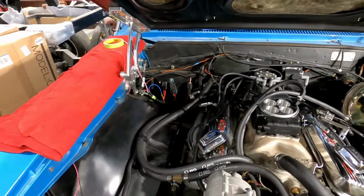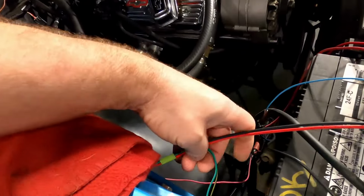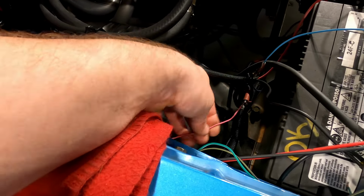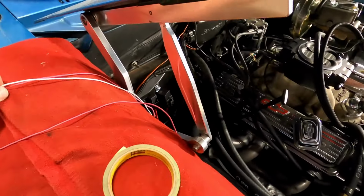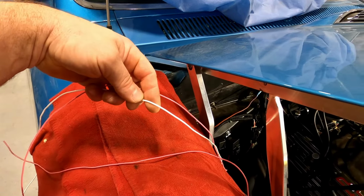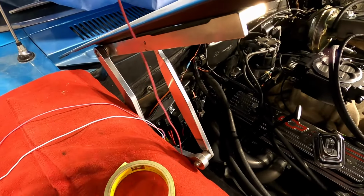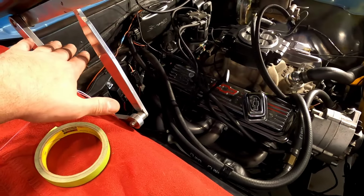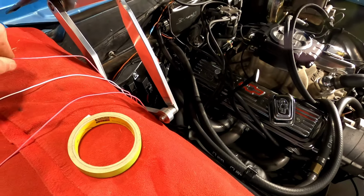All right, a little bit neater. Got my wires run up here. Power and ground for the sniper, fan 1 and fan 2. This is my ignition power for the fan relay, which I'll get into in a minute. This is, like I said, my trigger feed for my HyperSpark. This is my ignition power for the sniper. This is the other side of that ignition wire. I'm going to make a relay over here somewhere to do all of my 12 volt switched ignition feeds